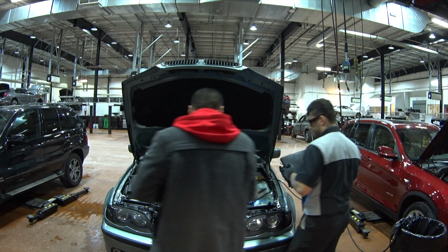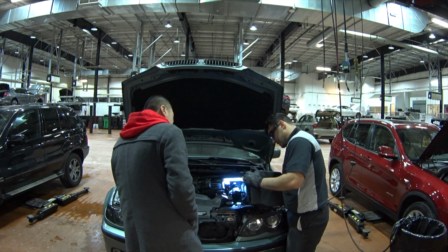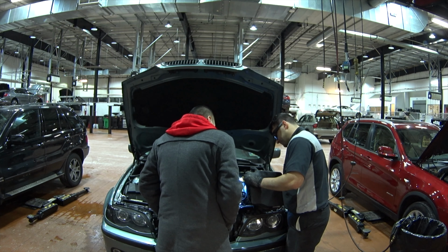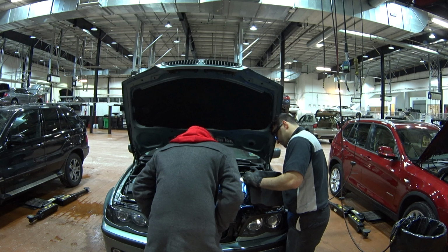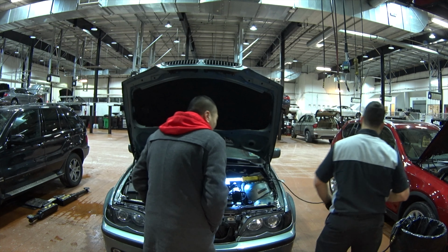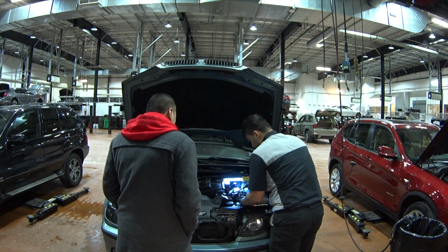The intake diameter of the Sulev 330 box was larger than the 325 box, leaving a 1/4-inch space around the mass airflow sensor, so it does not fit. A second attempt at an OEM intake box was purchased for an additional $20 off of Craigslist, which ended up being for another 330 setup, which resulted in the same problem.